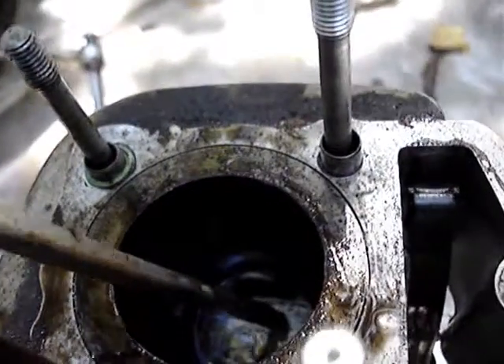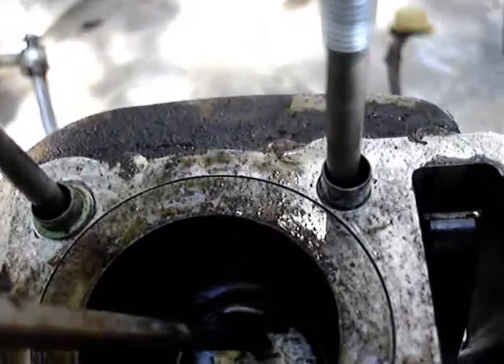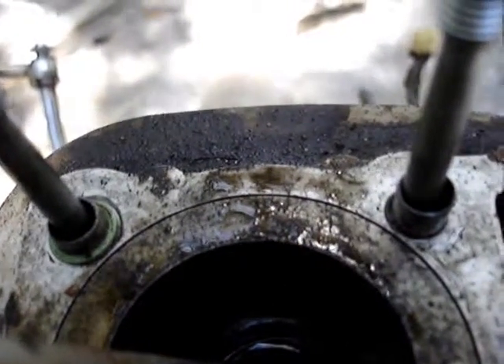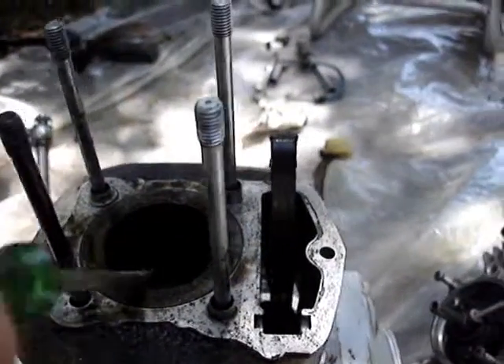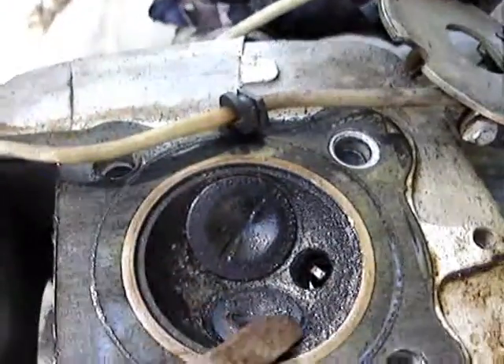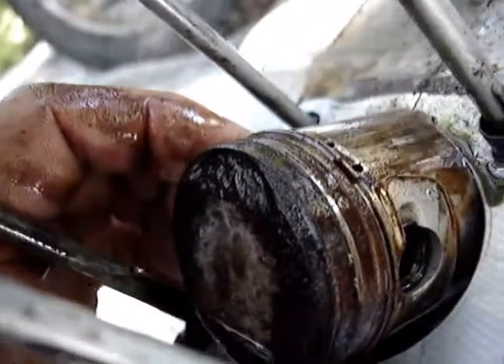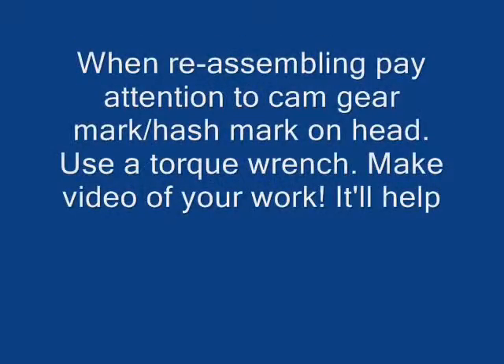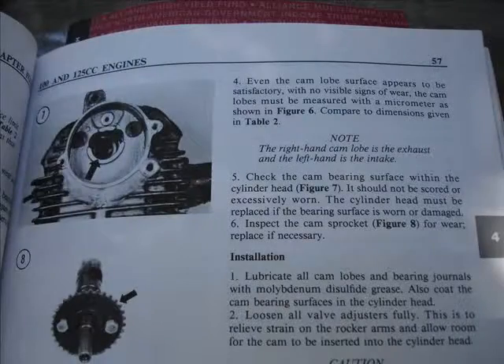So we have what's technically known as caca. I've almost got the piston out but there's resistance all the way to the bottom — I'm assuming the rings are probably frozen in place in an outward position causing resistance. We've been going about 20 minutes and first we only had it down to about there, but now we've got it almost all the way out, about a half inch to go. This is also known as caca. So this is going to need a piston and rings — we can tell from all this carbon buildup. The oil ring is loose but the top ring is frozen, and in between there is rust, and there are scrapes on the skirt. That's a prime candidate for a new piston.